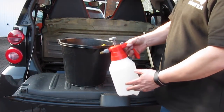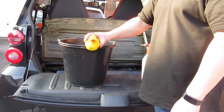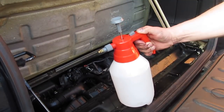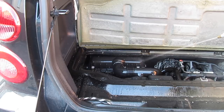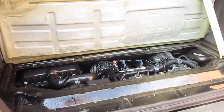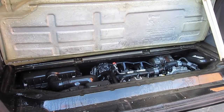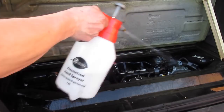The next thing I'm going to use is just an ordinary spray pump — this cost me about £6, about $8 or $9. You just put water in it. I use it for cleaning the car, and a soap-free bucket — just fresh water. I'm going to fill this up with plain good old-fashioned tap water, pump it up under pressure. There's no need for a jet wash here — I think it would just make an awful mess, so I decided to have more control and use this. The engine is actually running. A long time ago, maybe about 20 years ago, I did a bit of work in a car dealership and they always used to leave the engine running when steam cleaning — effectively putting some gunk in the engine bay and then blasting it with a jet wash. So I've decided not to take any risks. All I'm doing is diluting the gunk I've applied to the engine bay and trying to get it to rinse off as much as I can.